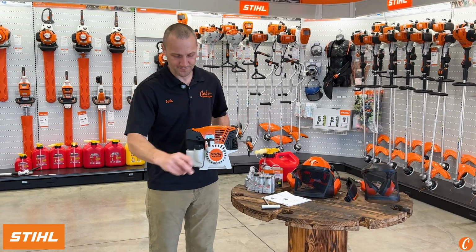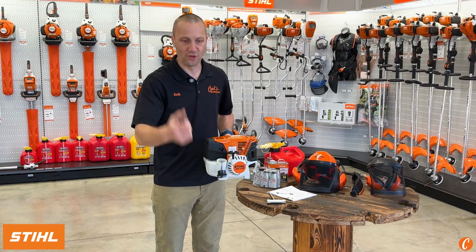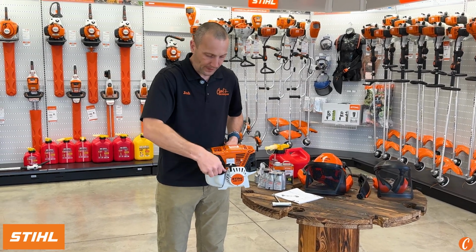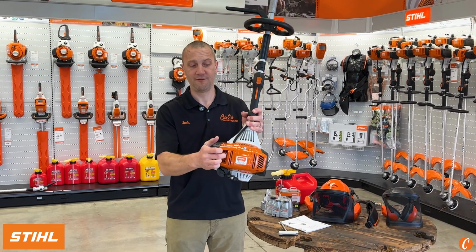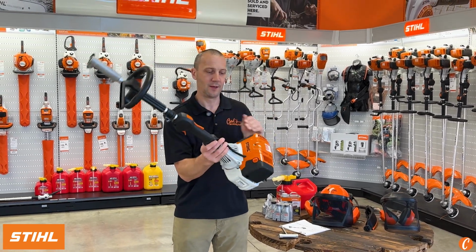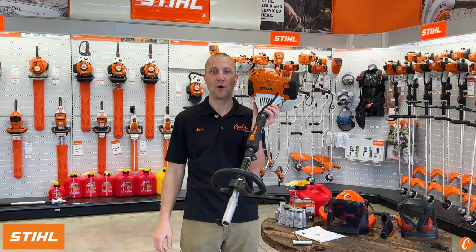Fuel's going to go in here. Remember, good, high quality ethanol-free fuel. Boom, fill the fuel tank, prime it up. 1, 2, 3, 4, 5. Choke it. That's right here on the front. I'm gonna push and I'm gonna twist. The choke is now on.